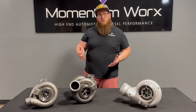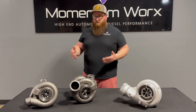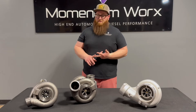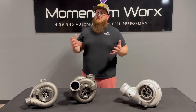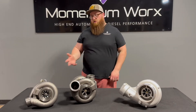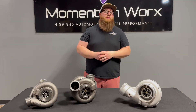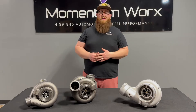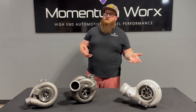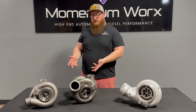The big drawback of the ACERC is the complexity and financial side, because when you go to service something on these, it's inevitable — you're going to break a clamp, you're going to break a bellow. This stuff is rusty because it sees a lot of heat. So when you're taking these apart, chances are you're going to need more than just the turbos — you'll need some extra hardware. Whereas with a single turbo, it's just one turbo, there's no bellow, no pre-coolers, a lot less going on. It's much easier to change and work on, and much cheaper.